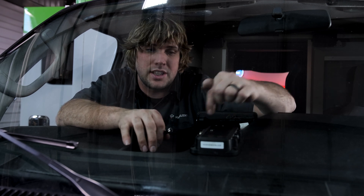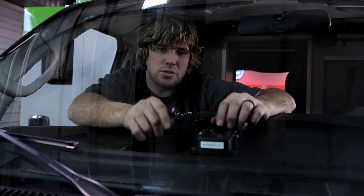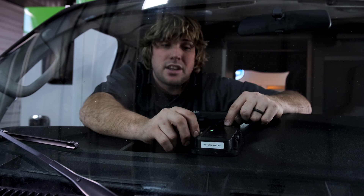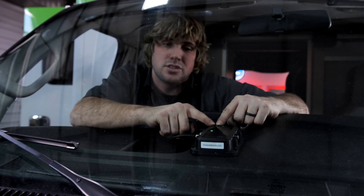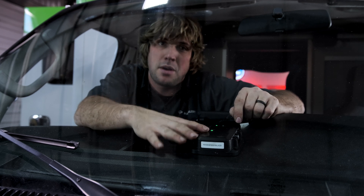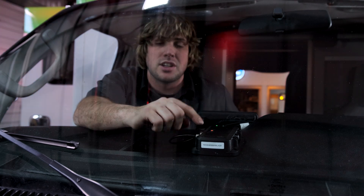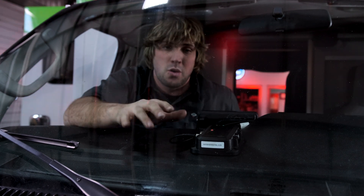The last step in the installation process is hooking the device up, attaching it to the dash, and testing everything out. You can screw this thing in using the four screws in the corners, or use double-sided tape or a Velcro system — just install it so it doesn't come off in a collision. Plug the hardwired cable into the side of it. The light on the left indicates it's connecting for cellular; the one on the right indicates it has a GPS lock. When it's steady burning, it's locked on; if it's flashing, it's still searching. If it doesn't stop flashing, pull the device outside and let it see a clear view of the sky. The cellular indicator will turn blue with a breathing on-and-off pattern, indicating a good cell connection. Finally, test the Responder-to-Vehicle and Responder-to-Responder function by turning the ignition on and firing off your E-master. It should turn orange, meaning it's broadcasting. After about a minute and a half, it will start flashing to indicate an incident location — that means everything is working 100%.